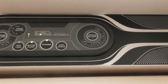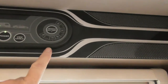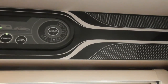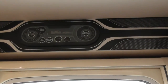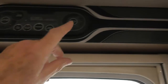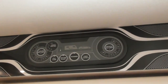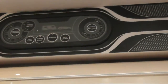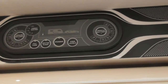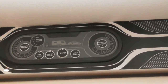Why is that red one flashing? That's to say your fresh water tank is empty. Why have you got 'leisure' and 'vehicle'? Well, that's the car. In years gone by, caravans used a lot of 12 volts from the car — they've still got that option on this. If you click on vehicle, it will drain your car battery back. So that is when you're on site, not when you're travelling. If you're on site and left it connected to your car and wanted to use 12 volts from the car — it's probably not a good idea, especially in modern cars. It will automatically go to leisure — that's the default — unless you definitely press that button to put it onto vehicle.